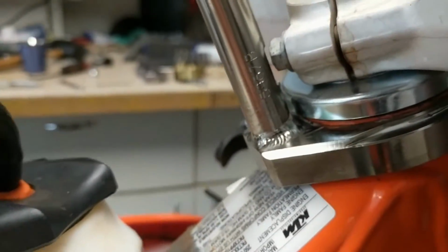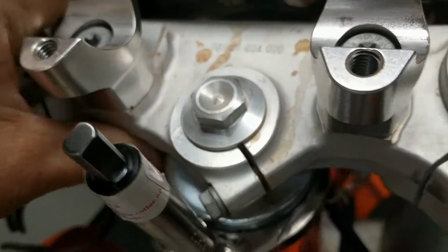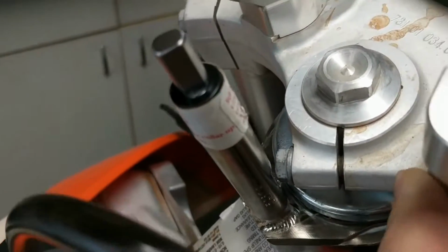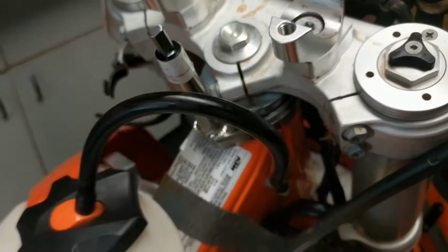Okay, so I wanted to show you this little bolt in here. Barely slides by. There's a little notch in the back of this post here. And let's see if we can see it better on this side. But it barely slides by there. And they put a notch in the post so that that bolt, this triple clamp bolt here, when this rotates, it doesn't hit that post. And I thought it would, and it was looking kind of funny and shaky, but it made it.